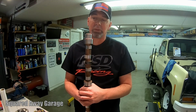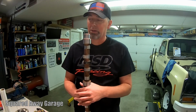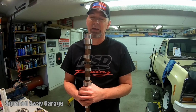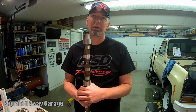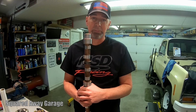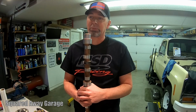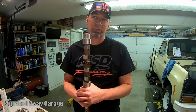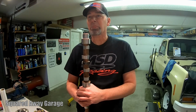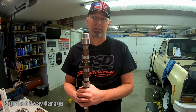So the engine had to come apart. And when the engine came apart, that's when I found the cam was delaminating. So that was a blessing, because there wasn't a lot of material in the engine yet. I didn't find any evidence that anything heavy had gone through any of the bearings. I couldn't find any evidence that it had gotten into the oil pump. I did find some small particles in the bottom of the pan, and a few particles in the oil filter, some real fine glitter in the oil filter. So everything got caught early, and it was because of the problems created on the dyno.